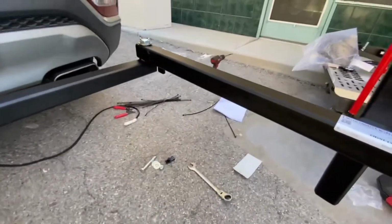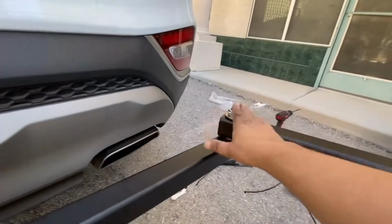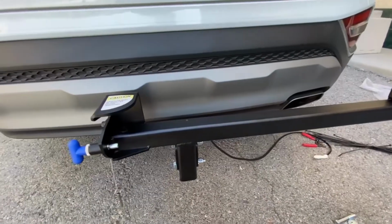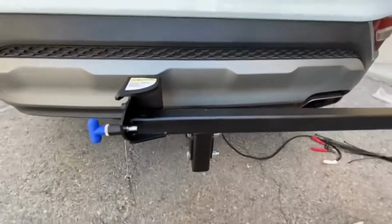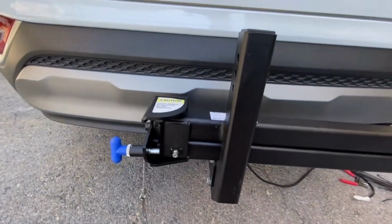Never operate these swing aways with something on the lift, just the lift alone, otherwise you'll sprain this point and it'll never shut correctly. I had that happen on one of mine. It was a used one and it was sprung out forever, having to lift it up to get it into this piece here. When it shuts, it should shut nice and easy.